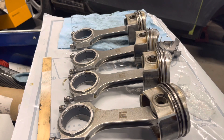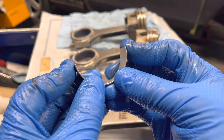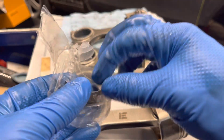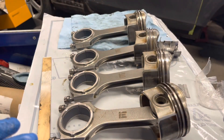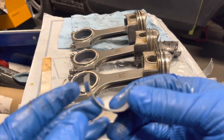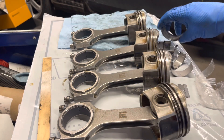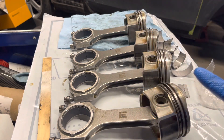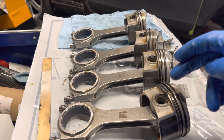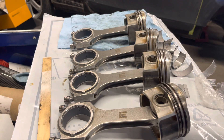Now that we've got the pistons in, I just want to talk about bearings. You always want to be mindful of the last bearing that's in the pack because it's under the most tension — there's cellophane wrap that goes around these. I actually had a situation where the bearings that came with these rods, the last two bearings were crimped in a little bit just because of the maintained pressure. So I had to take out all of the bearings I had already installed just to double check and get a new set. Now we're getting ready to lubricate everything up, drop these pistons down, make sure the ring gaps are in the right positions, drop these pistons in the bore, and then we'll get to spinning over and make sure everything is good.